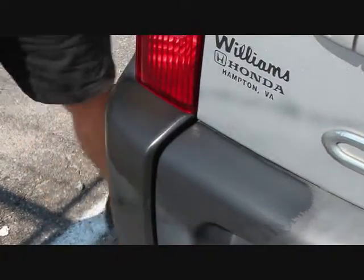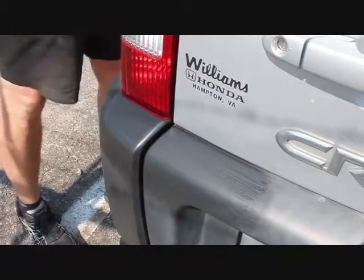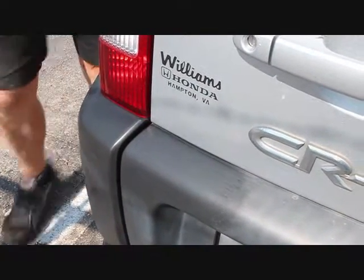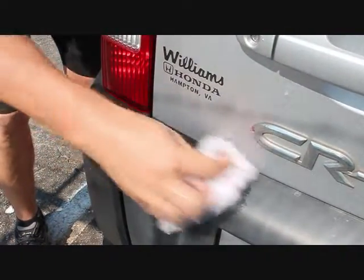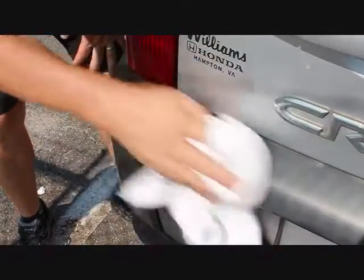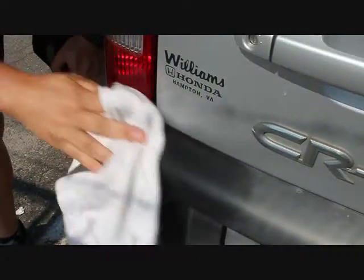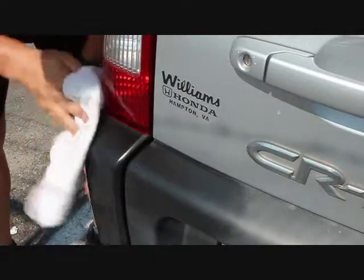Okay. And just like any other area of the car, we'll now take a rag with some water on it and apply a water sheen. That sets the acrylic. And after that, we will buff it out with a buffing cloth. And let the sun hit it for a little minute, just so you know it's not water making it shine.